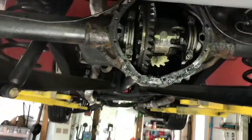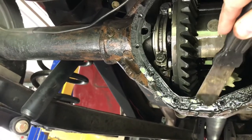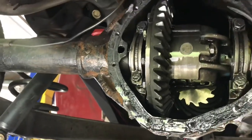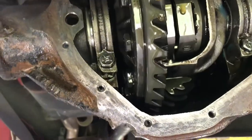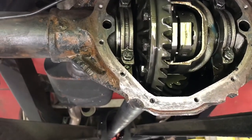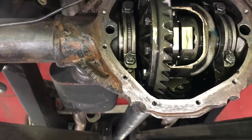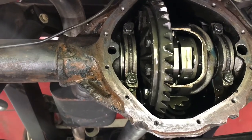Had the old gasket material scraped off — here's what that center chunk looks like. That's what we're going to be taking out, and we'll put this cover back on. A lot of different opinions on what you should do, but we tried the gasket and it still leaked at the bottom. So this time we're just going to go with the RTV, seal it with that, get a good thick layer of it, and see if it works any better.